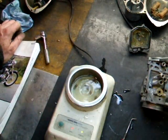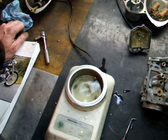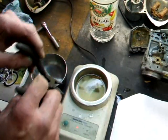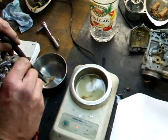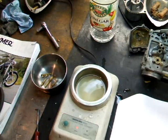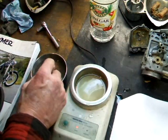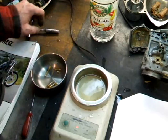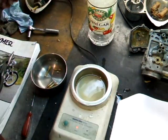It's been running about five minutes and I still see stuff coming out of the main needle jet. When they're all done, I fish them out of there and drop them in clean water. I let them sit for a little while and stir them around just to get the vinegar off. Vinegar is a mild acid, but it's biodegradable and non-toxic, which is why I like to use it — and it's cheap and it works good.